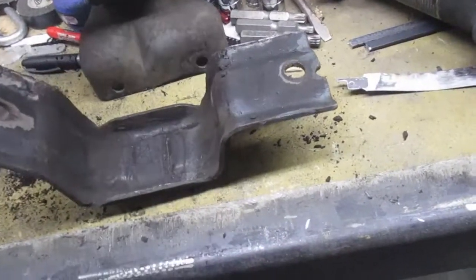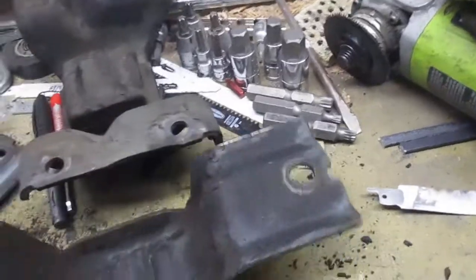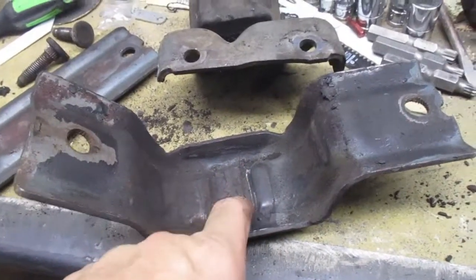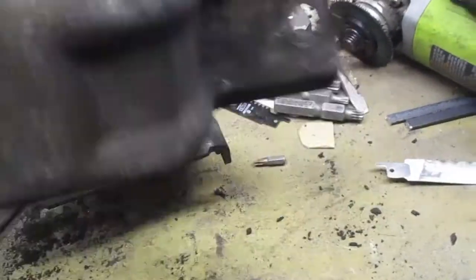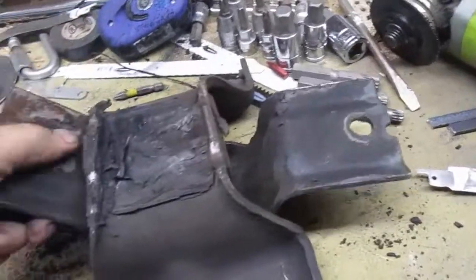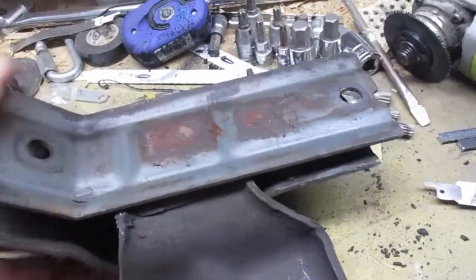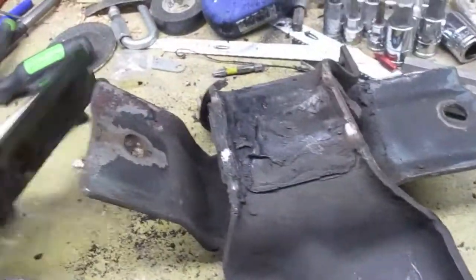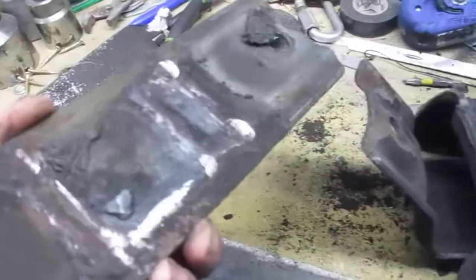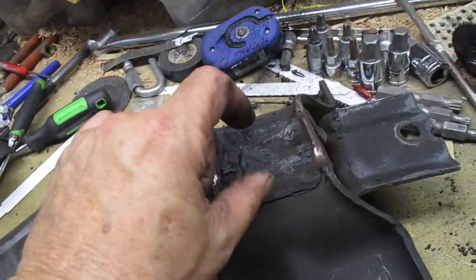When I go to the Ford dealer, they sell these individual pieces — they don't sell the completed unit. So I'm thinking they expect you to fix it yourself. This piece of rubber is not actually attached to one side; it just goes on there. What holds it in is the other side — you squash it down and that holds it together. So what I need to do is remove all this rubber, get it down to bare metal, grind it down, then get some liquid rubber and fill it full, and then squash them together.